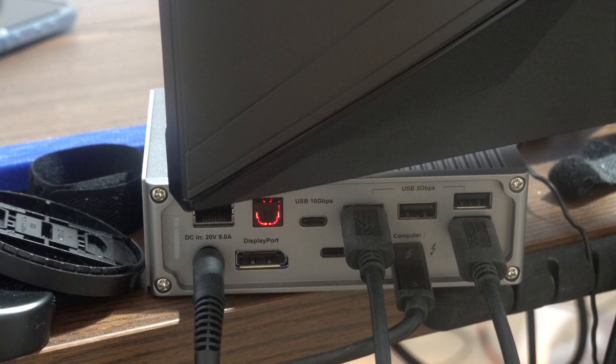If I go back to Gen 3 I lose all those benefits. So the only resolution that works for everyone is to go into your BIOS and change from Auto or Gen 4 back down to Gen 3 — basically restrict the bandwidth on your motherboard. What I've had to do instead is run all of my cameras through my Thunderbolt 3 hub. It's strange that the USB ports on the motherboard aren't getting enough bandwidth, because I can run everything through Thunderbolt 3 via the X4 slot and everything is fine.